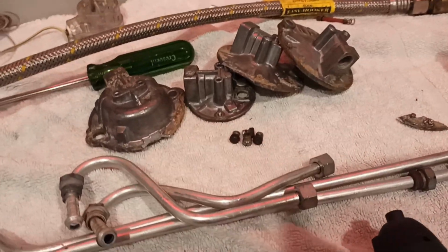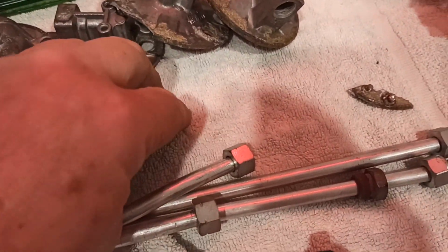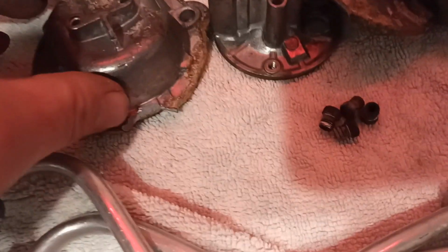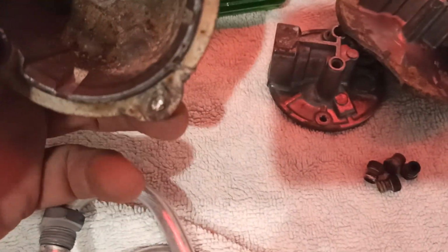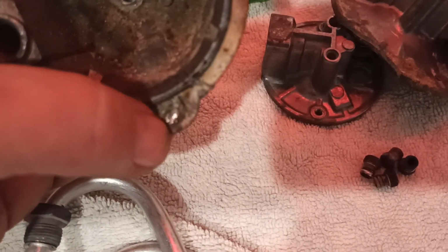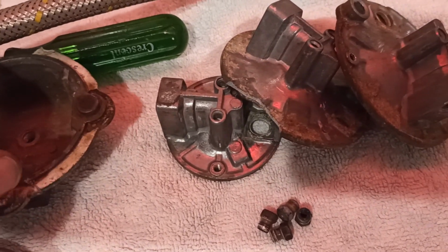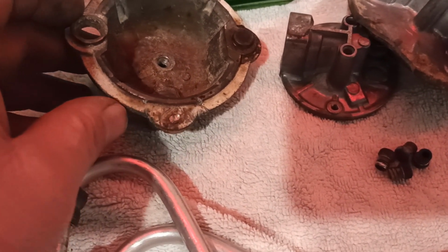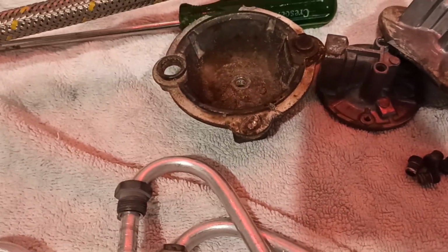So that's the burners done, more or less. The cheapie, what did we get from that? Four little brass jets, and the burners are alloy, cast alloy, and as you can see on that one there, it's still got a screw in it. A couple of the others are broken off. I just managed to do it with side cutters. That one there I'll take downstairs and give it a belt with a hammer in the vise. That'll break that off, or you throw it in as irony aluminium.